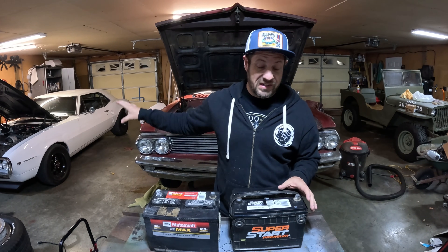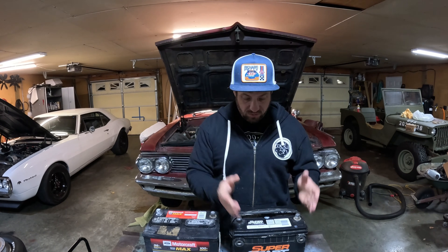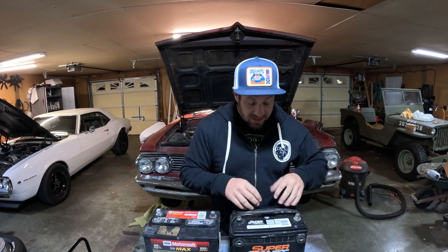The NOCO Genius comes in higher-amperage units. I explained why I specifically wanted just the NOCO 1 at one amp — so it wouldn't hurt my aftermarket fuel injection system. But you may not have that requirement; for you it may be worth buying the 5 or the 10, which charges faster and has more functions. The NOCO 5 and 10 actually have a repair mode. I have no idea how well it works or if it's just a gimmick, but they say it can desulfate a battery. I might actually buy a 5 or a 10 to test and report back — we'll put it on both of these bad batteries, and there's a chance this one that's trying to work might be brought back around. Maybe you'll see it on a future episode. Please like and subscribe — we'll see you next time.